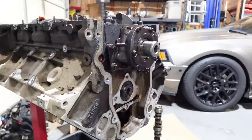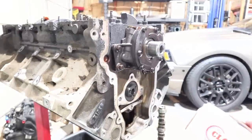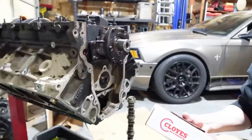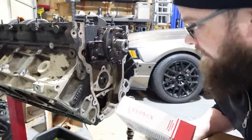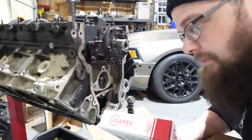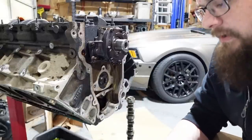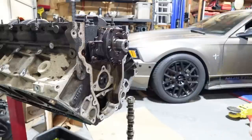I brought Mr. Bucket and you and I are going to have some talks here. I'm going to do something a little different — I'm going to do an all-motor L33 with a cam towards the wild end, still an off-shelf setup but a higher RPM max power kind of thing. I don't usually do that, but I'm going to do a bunch of things that will lend to good testing and possibly good results.